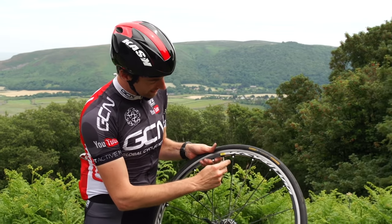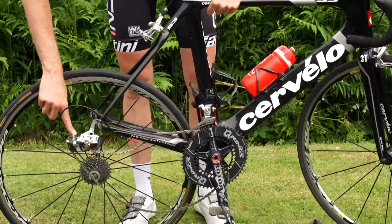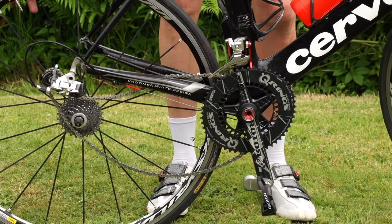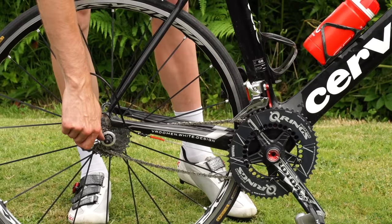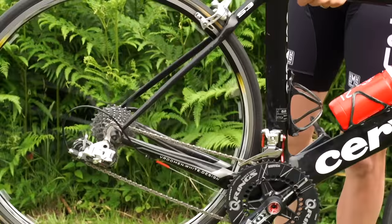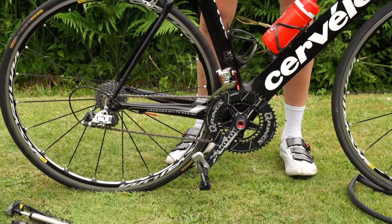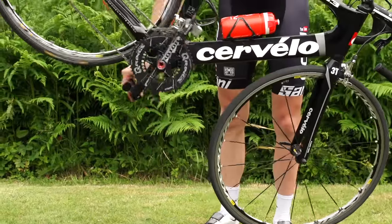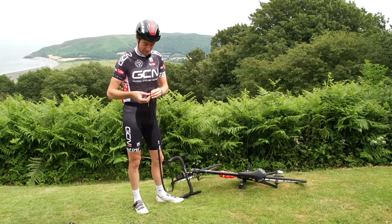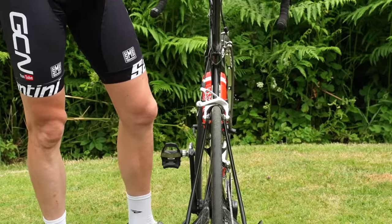We're ready to put the wheel back into the bike. Just do the valve up here again. Almost in the same way that you took it out, push the rear mech down — the cage part at the back — and as we've already put it into the smallest cog, that's where you want to rest the top jockey wheel. It should just slip in. Before you set off, just give a quick bit of pedalling to make sure that the chain's still seated properly on both the chainring and the cogs at the back. You might even want to put it up a few cogs if you're starting back on a climb. Then it's just a case of clearing your rubbish and your tools up. One last thing though: if you have loosened your brake to get your wheel out, make sure that you do it back up.